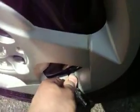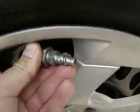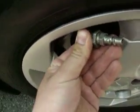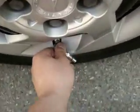Keep deflating until you hear a horn chirp — there you go. Then move right on to the next one. Sometimes it takes a while, sometimes it's quicker; it depends on the condition of the sensor and how old it is. There we go — and we move over to this one, the right front.